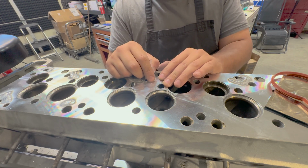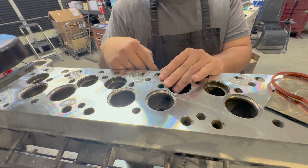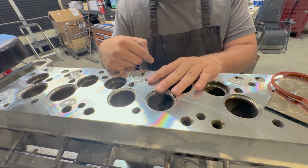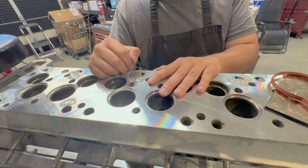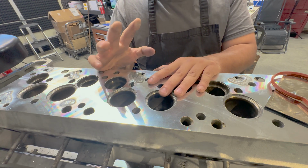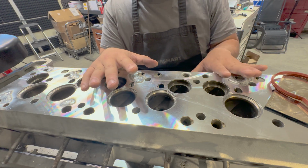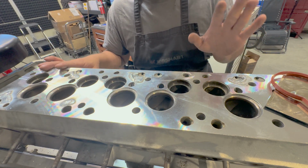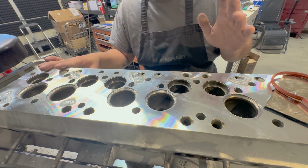Not necessarily, I guess you could if you wanted to, but it doesn't necessarily add more penetration to the weld. There's just some kind of reaction with the arc, and you're instantly lighting up on that aluminum. It works awesome. Since I started using straight helium, and I should have really, from the beginning, just used straight helium, it would have been so much faster, and I would have saved myself a bit of headache.